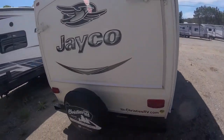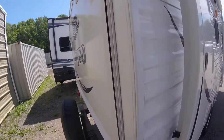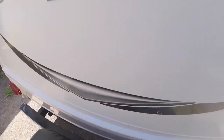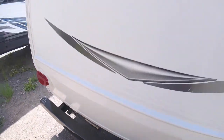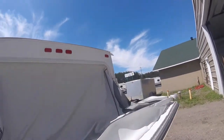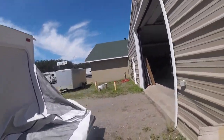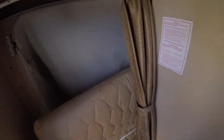So to begin with, we're going to open up the back portion. It's important to notice that the bed height when it folds out is over top of the trailer, so you need to remove this pin and then remove this pin and let the tire hang down. I always put this back so you don't lose it. Now these do lock — I've already unlocked them. Open that, open that. You can fold your tent out. You also fold these corners down so they go over top. Now we'll go inside and open that up.